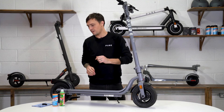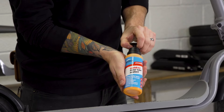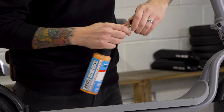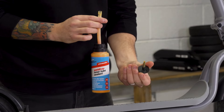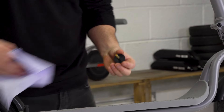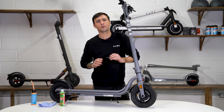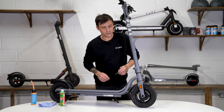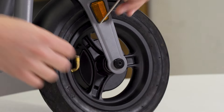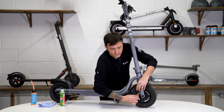Today we're going to insert PPF into the front tyre of this scooter — it's the same for the rear, you'll just have to work on the other side. First, open your puncture prevention fluid and remove the cap to reveal your tool. Next, remove the valve cap. Then, using your blunt implement, press on the valve core gently to let the air out.